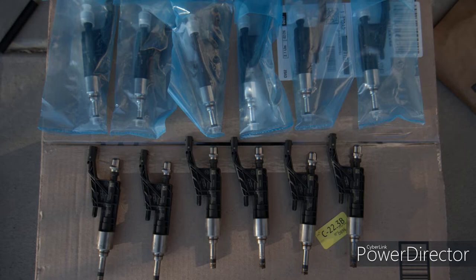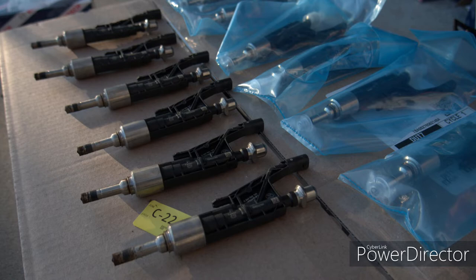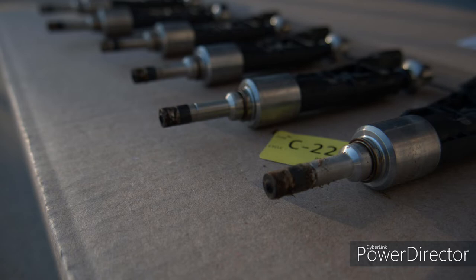From this point on, you're just going to reinstall everything that you already took apart. If you need help with that, just watch the video in reverse. These Teflon rings — the small little rings that are at the bottom of each of the injectors — they're going to come pre-installed, but if you're pulling your injectors out yourself and planning on reinstalling them, you need to buy new rings. You have to renew them. That specialty tool used in this video does come with the items you need to add the Teflon rings back onto the injector, but you cannot reuse the old Teflon rings.